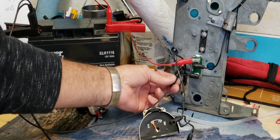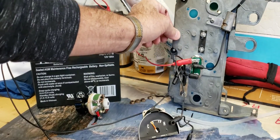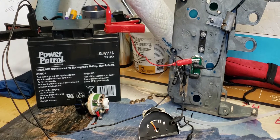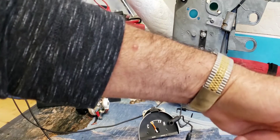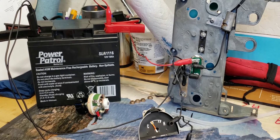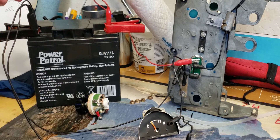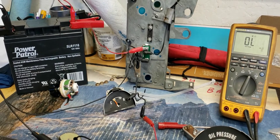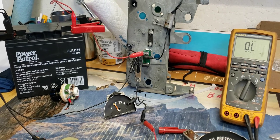It also needs a negative — this one has a little negative terminal built on. Some of them have another terminal on the cluster, or the cluster itself is negative. That has to go to battery negative. Your instrument draws power off of the limiter into the instrument, then from the instrument it goes to your sending unit. On the car the sending units are all grounded to the engine and chassis — bringing that case of the sender back to battery negative. If you have any questions, put them in the comments and don't forget to like and subscribe to Big Paul's Garage.